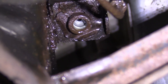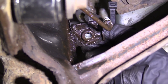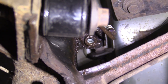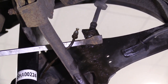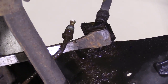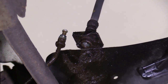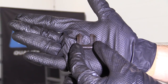Right here there's a clip that comes through from this direction — it's like a horseshoe and just slides right through, holding this flex hose into this bracket. You can do whatever you have to do to get that out. For me personally, I just like to give it a couple bonks and drive it right out. It's starting to come off — it could go anywhere. There we are. So we've got our little U-clip — that just goes around the brake flex hose and locks it into the bracket.